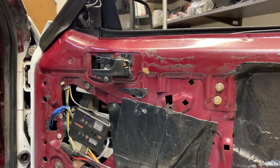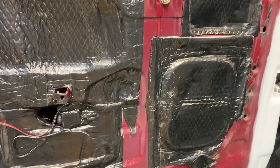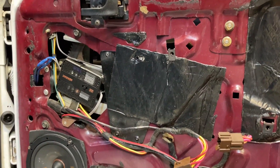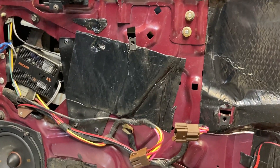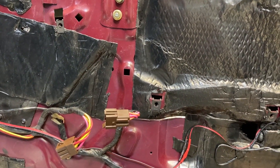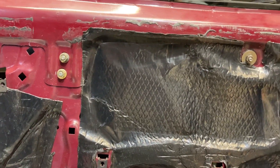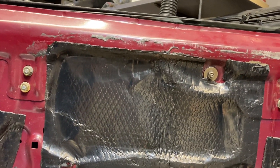I've got pretty much all of the butyl off the door and off the vapor barrier, so I'm not going to mess with trying to patch in old stretched-out pieces — I'll just replace what I need with fresh material. Here is the door — you can see I've got some sound deadener pieces in there left over from a trunk project. I took leftover pieces and covered a lot of the holes to make it quieter. I've also got a couple pieces on the inside, and I rolled the window up and put a couple on the outer skin in the big flat areas. Where the holes are, when I go to adjust the window I'll cut out some of this, and when I'm done I'll stretch it back and it'll be just fine.